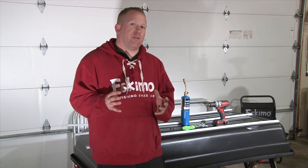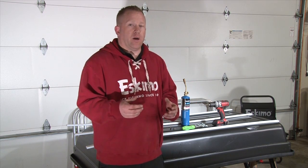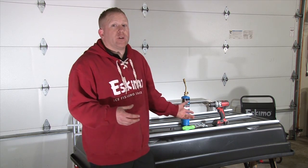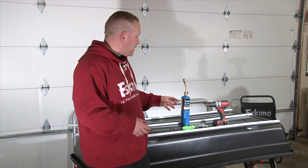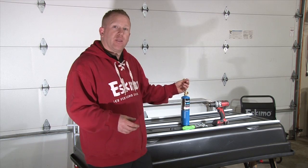One of the things that I always do to protect my investment is install a runner kit on the bottom of my sleds. This will make sure that you don't burn any holes in the bottom, protecting it for as long as you possibly can own it. A couple of tools you're going to need: a propane torch — it will help you bend the hi-fax once we get started — a 3/16 inch drill bit, a 3/8 wrench, and a screwdriver.